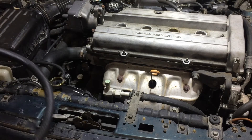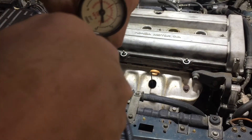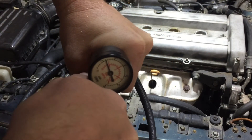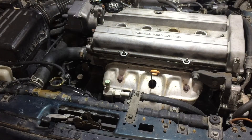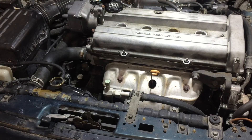I've got a little redneck rig here with my air compressor. I've set the pressure on the regulator — you can see it's bleeding down, but we're at about 12 pounds. If I seal it off it comes back up to about 15 pounds. That'll keep me from over-pressurizing the system — only 15 pounds — and I'm going to see if I can get enough pressure in here to make it leak.